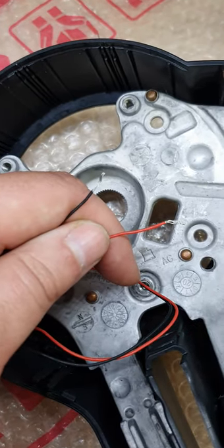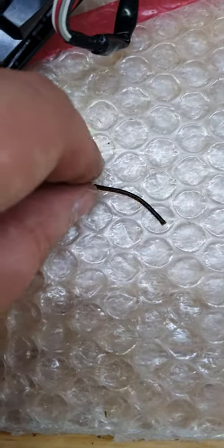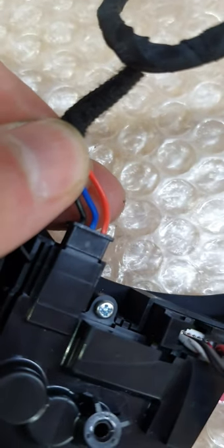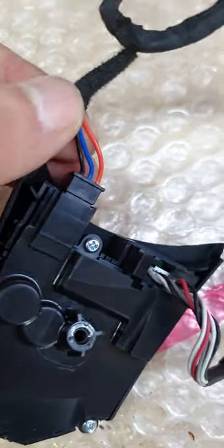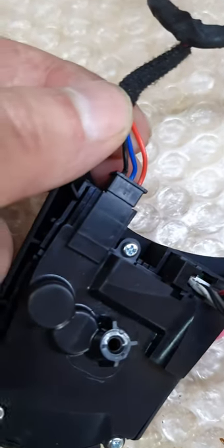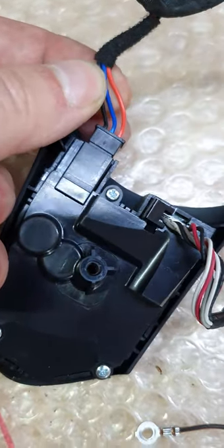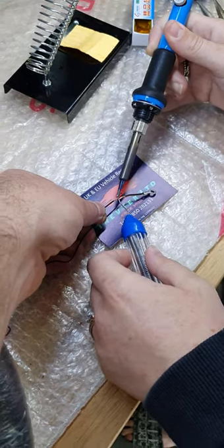The power to the LED display — we've got a positive in red and your negative or ground in black. I thought I had some spade connectors but I don't, so we've cut one from a loom from another steering wheel we're not going to use. We're going to strip that back and solder it together. We'll take our live from the red cable leading into the multifunction buttons and solder that in and tape it. You could just cut away the casing, twist it and do the old-fashioned taping, but in a car like this with a lot of vibration Joe's going to be doing several thousand miles, so we don't want it disconnecting randomly. We'll make sure it's on there nice and tight, with a little bit of electrical tape to cover the join, and you can heat it up with heat shrink to shrink it down.